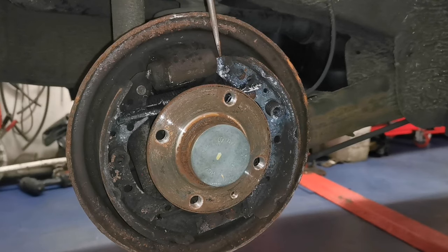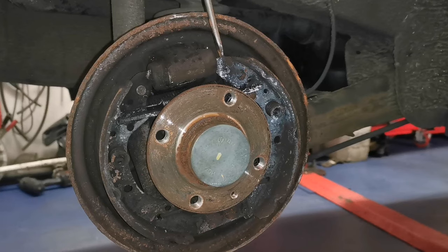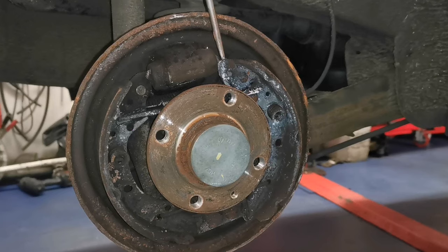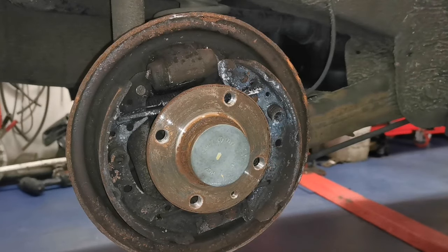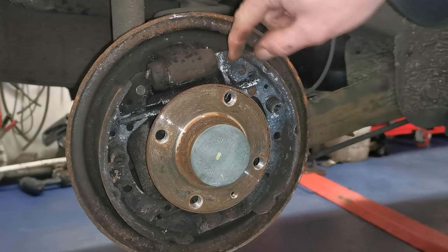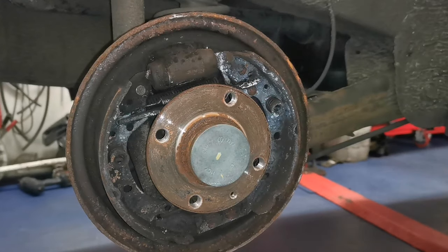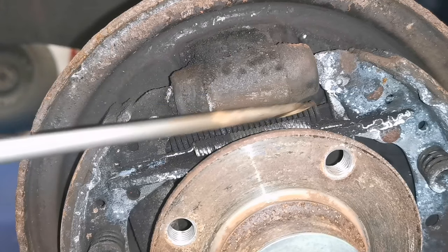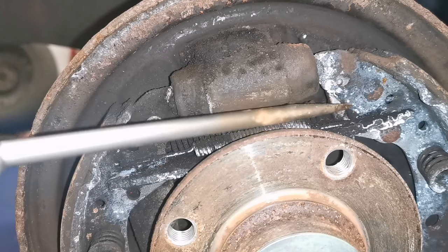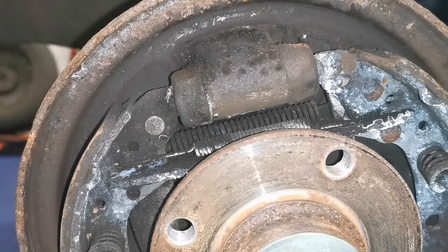Some people might think what are you doing that for - you mad? There we go, knock that back into place again. So that's our wee wedge pushed down again. The idea is to bring these shoes out again and put a wee bit of tension on this spring back here. That spring is under a bit of tension and the wee wedge is back down. The reason for that is so that the shoes are out and then the wheel cylinder will come towards us.